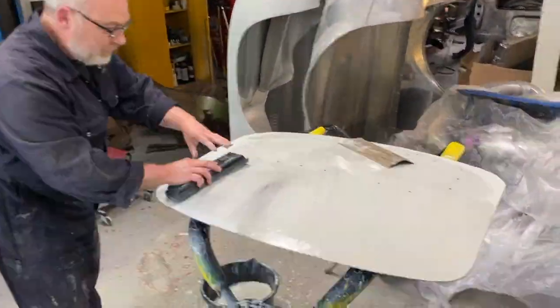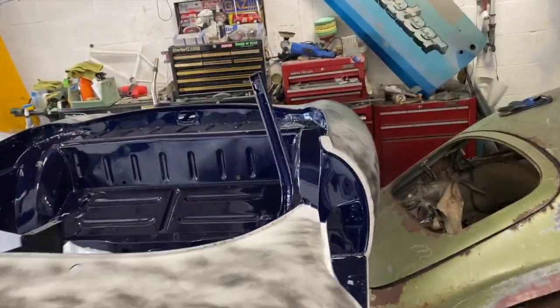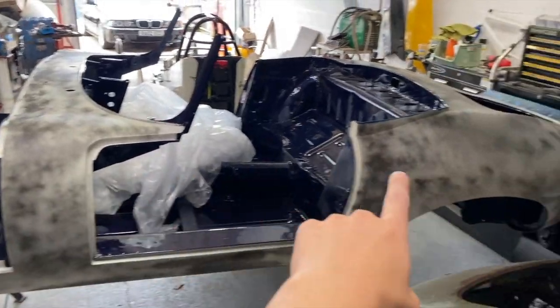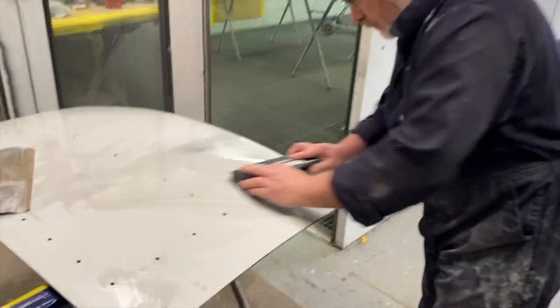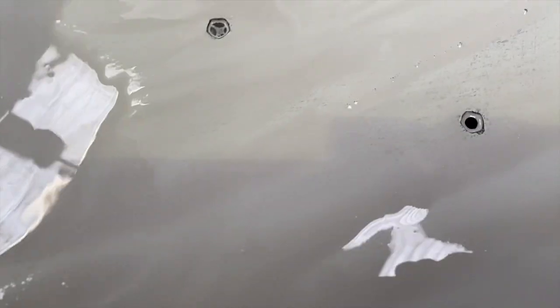So Aid is now out here. He's started the wet flatting stages. So you can see, if I come over here, he's put the guide coat on the shell, and he's also done the panels. So you'll be able to see, there's the guide coat on there. And as he's flattening it down, can we see just in there? Just about, that's it. You can just see, there's the production marks and scratches. So that is what we're getting rid of with the wet flatting.